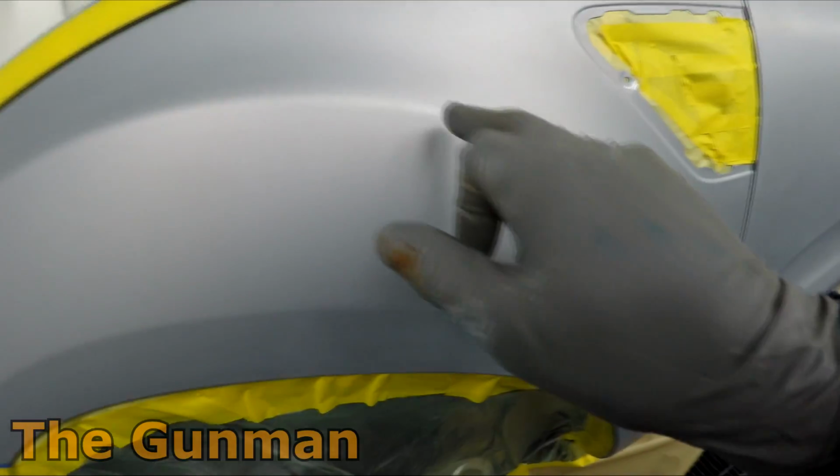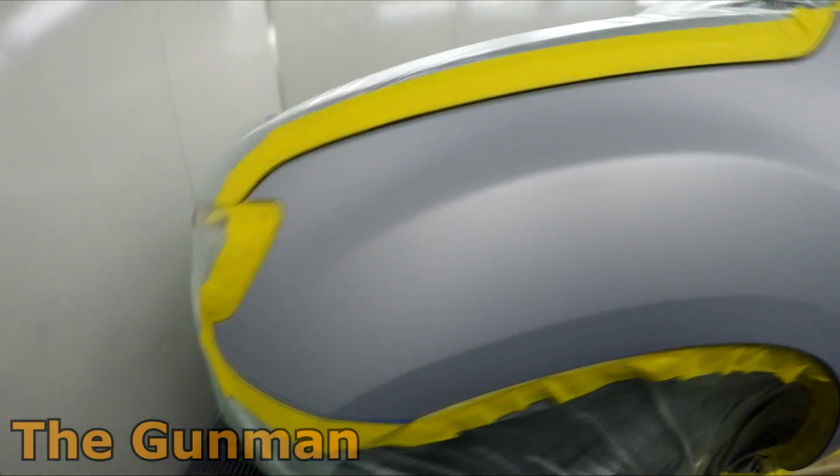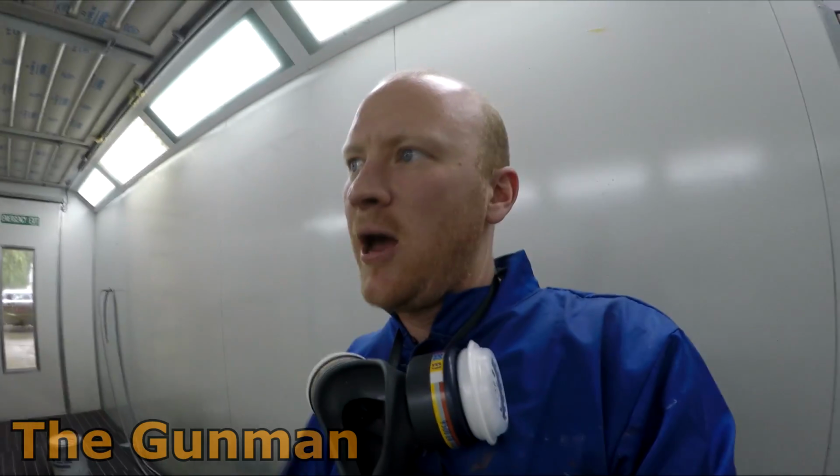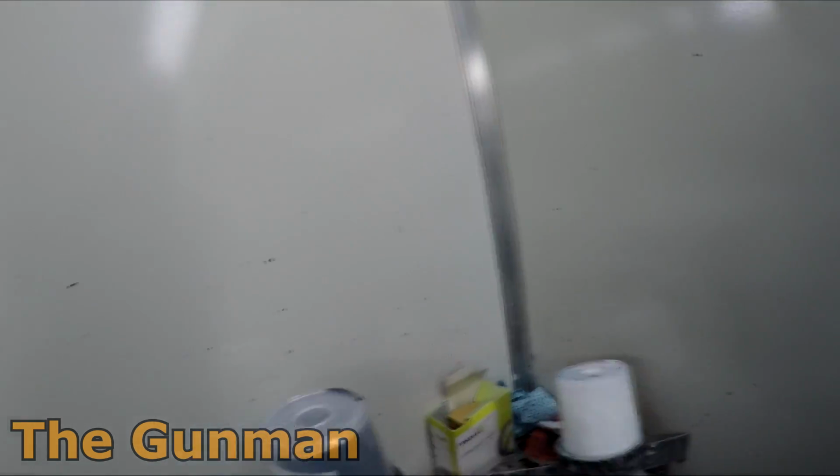but it looks like he's actually cut through here, so the blend is going to come fairly far up, but I'm confident in the colour anyway. We can actually mix some of the base coat blender, which is in this gun here. It's good practice and pretty much necessary, I actually think, to have a separate gun for the base coat blender.